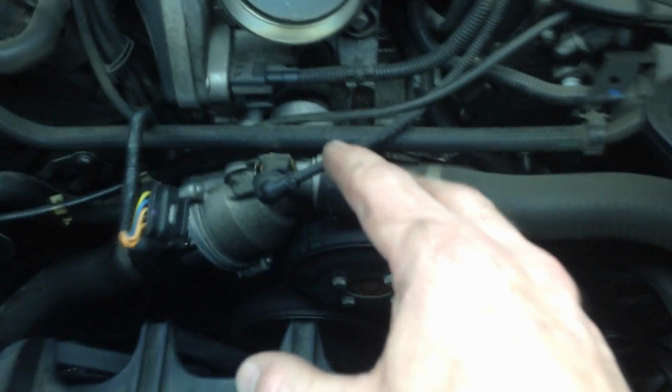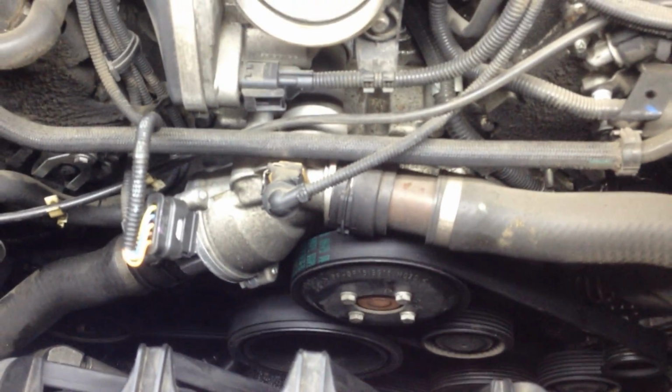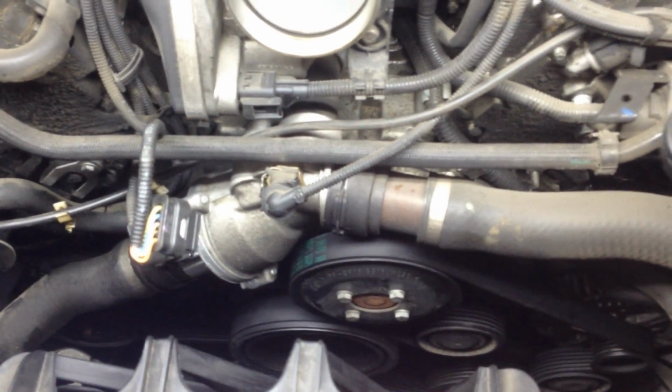What you want to look for is that your water pump is going, which means the bearing went bad, or the gasket went on you and you're starting to shoot sprays of coolant through the little gasket part, which is right where my fingernail is, that little line right there. That happened in my old Cadillac, and I'm not going to go through a whole tutorial on how to fix that, because I do need to replace it, but I don't have the new water pump with me right now, and you would have to remove this area to get back into here.